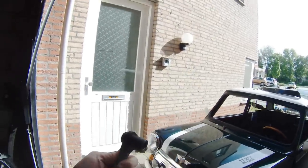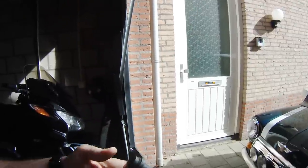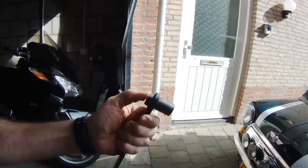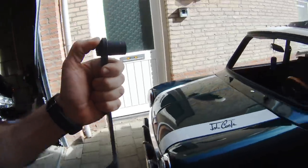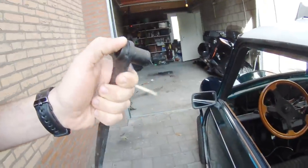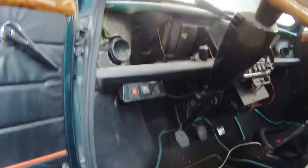What I'm hoping I can do is, instead of removing the entire pedal box, I'm going to see if I can undo the bolt at the end here and push it all the way through. I already undid the clevis pin, and I want to see if I can just drop the brake and the clutch pedal instead of removing the entire pedal box, because the pedal box is a pain — it's got a security nut on it.